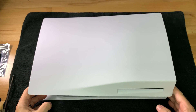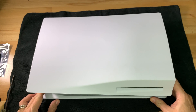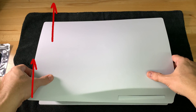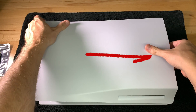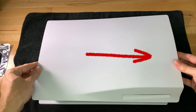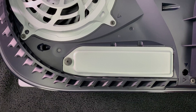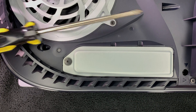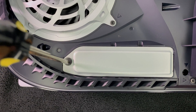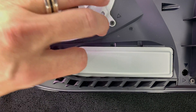If you have the disc version, this is the panel that is removed. Press up on the left side of the panel, mostly in the lower and upper areas, then slide the panel off to the right and it easily unsnaps. Place the cover out of the way. Zoom in to the area just below the cooling fan — this rectangular cover needs to be removed to access the SSD location. Using a Phillips head screwdriver, take out the screw.